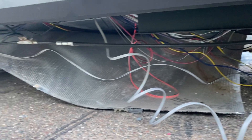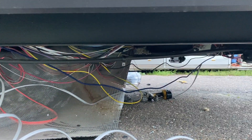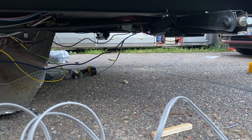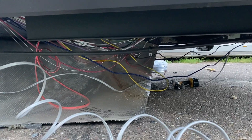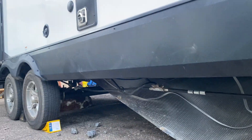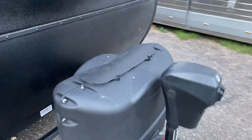Had to pull the belly pan down to get our lines through — this is pretty much the worst of it. I'm showing you this project because everything is torn apart, and from this point on everything goes back together. We're running from the far corner all the way over here for AC and data lines. This is a 30 amp coach, so we only had to run 10-10-2 wire.